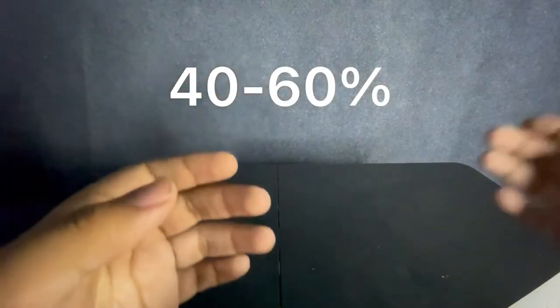The optimal operating humidity percent ranges from 40 to 60%. Printers are operable in any other humidity ranges, but understand that operating under 40% or above 60% will put the print head's overall health at risk and will also put your print quality at risk.